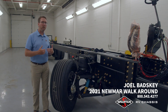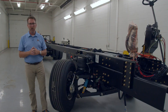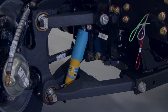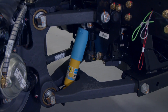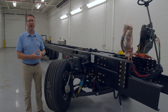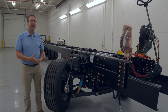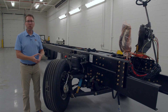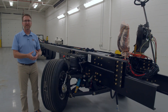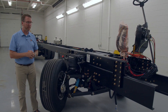First, we use Bilstein shocks to give you the best possible ride quality. What makes them different is they use a monotube gas shock. Because it's a monotube, I don't have a tube inside of a tube, so I get the best possible back pressure. If it says 46 millimeters, it's actually 46 millimeters. On a dual tube shock, if it says 46 millimeters, it may be much less, so you're not getting as much back pressure.